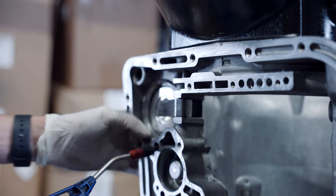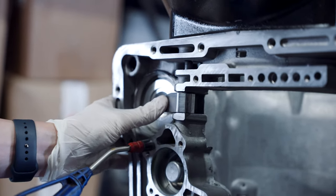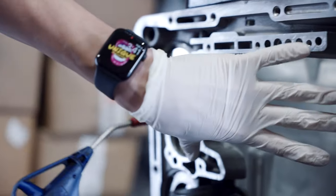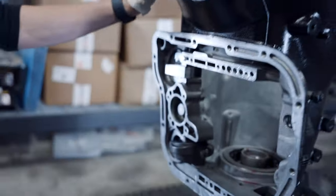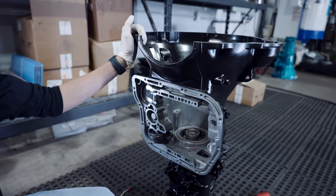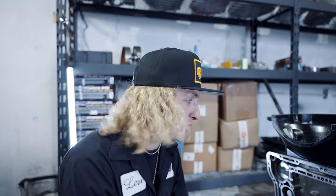By squeezing this, you're going to see this shoot out, and it's going to squeeze the band for a short period of time. And then it's going to apply, and then it's going to smack the direct drum clutches, essentially. I haven't really done a demonstration, so don't beat me up over it too bad on the transmission stuff. I just know the stuff by memory of what works and what doesn't.